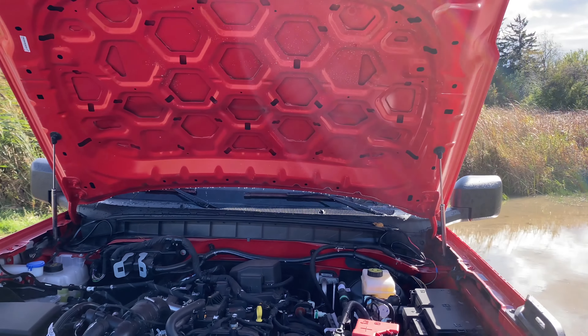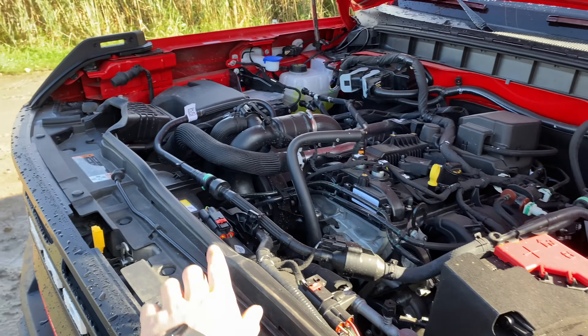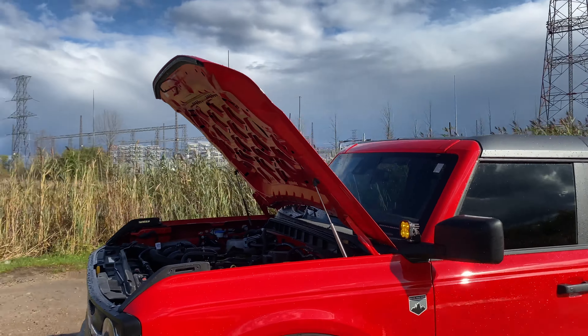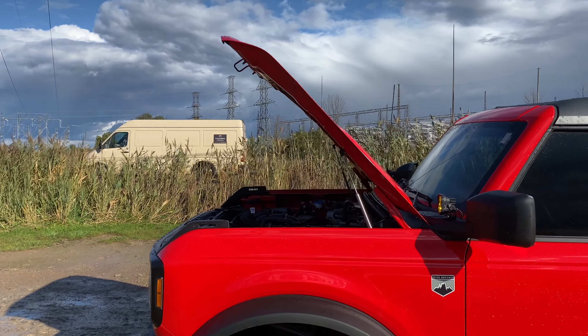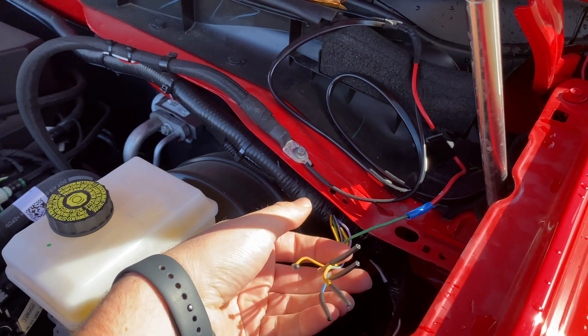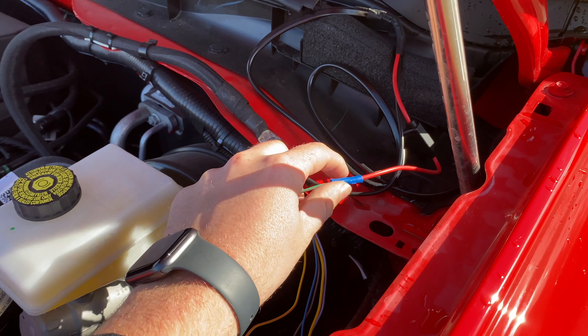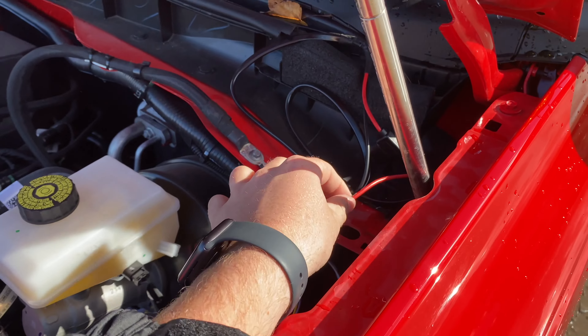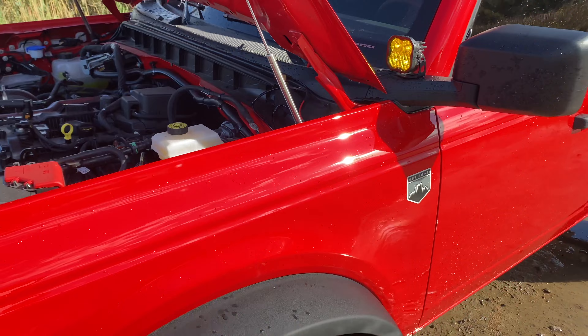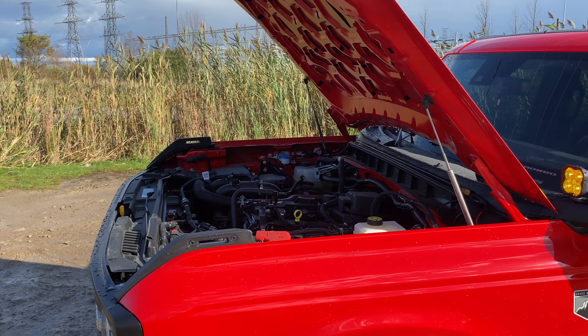Under the hood, one thing I did — which was a special gift from a customer of mine — is these Redline Tuning hood struts. Really nice; it eliminates having to use the annoying hood prop which doesn't open it very far. As you'll see from the side shot, this opens it up quite a bit more. This was super helpful because of the auxiliary switches — Ford has pre-run all of the wires for your aux switches. I've tapped into aux switch number two, a green and brown wire, for my LED lights. Highly recommend the Redline Tuning hood struts if you're going to be under the hood frequently.